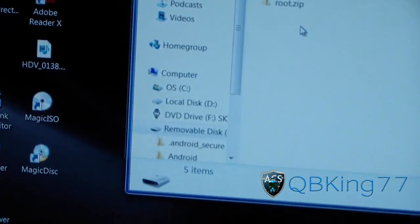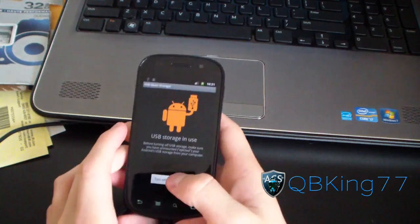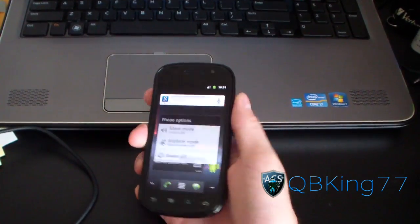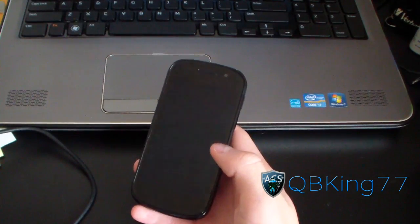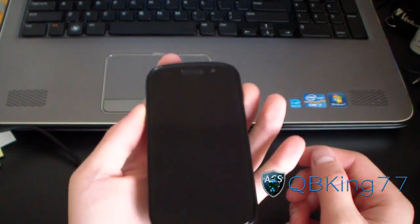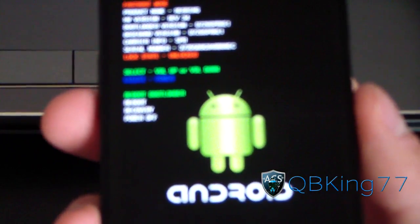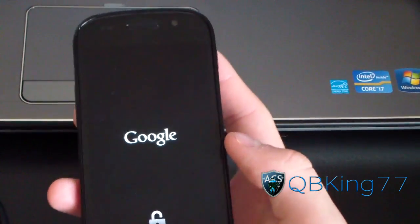You're ready to go. Go to removable disk, right-click, and hit Eject to eject your phone from your PC. Go back to your Nexus S, turn off USB storage, and unplug it. We need to go back into that custom recovery. Power off your Nexus S4G and let it shut down. Now press and hold the volume up and power button at the same time — that takes you into the bootloader. Then press the volume down button twice until you highlight Recovery, and press the power button to select it.